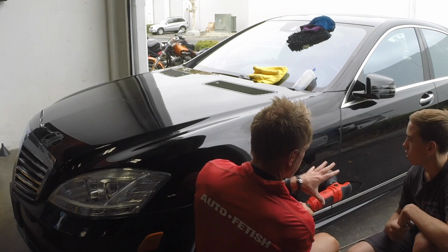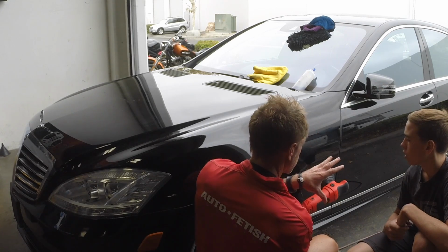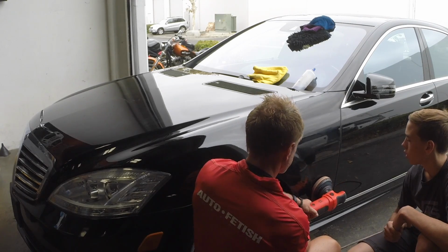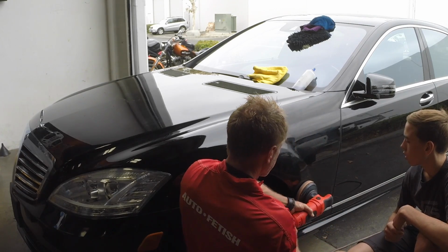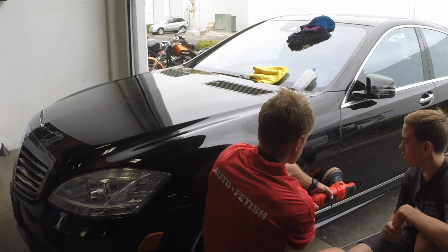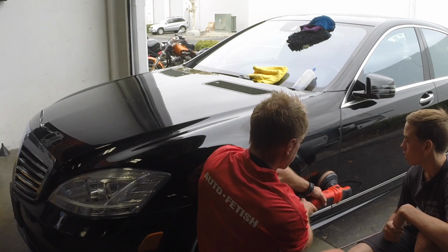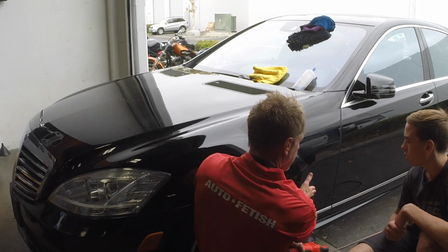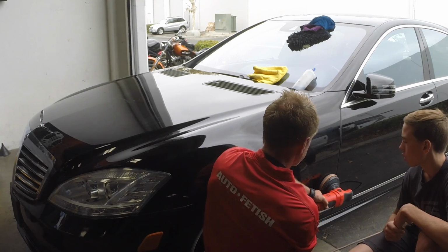Now this is going to happen no matter what. The pad is not going to always be perfectly flat. And sometimes I know you're trying to do it intentionally, but sometimes I can tell that it's unintentional because you're just focused on other things. So you want to remember, based on the panel itself, so flat on this panel, see how the buffer is angled against the whole car right here? And flat is almost perpendicular to this car here now. So flat here is different than flat here, right? What we're really concerned with is flat against the actual panel. So flat, flat, flat, flat.